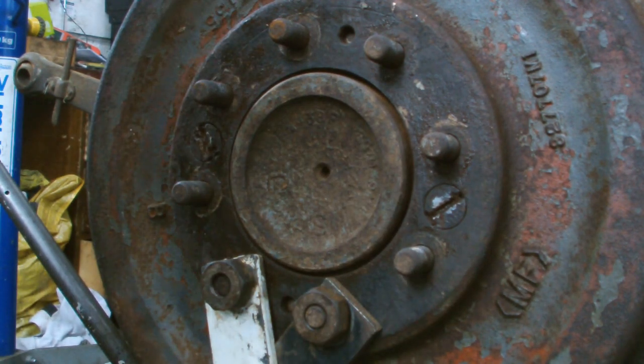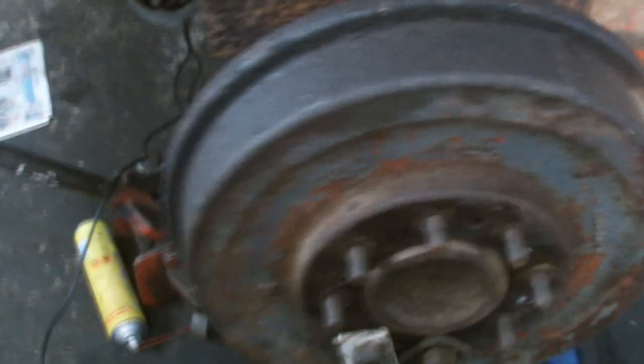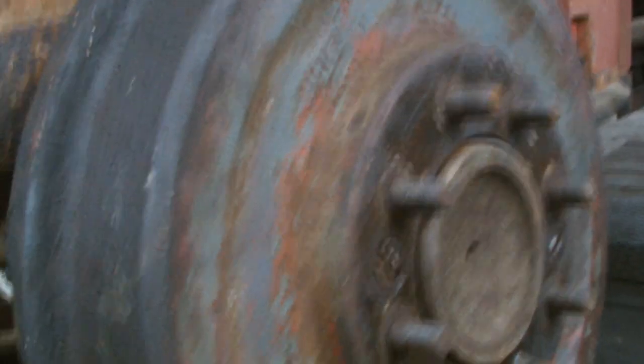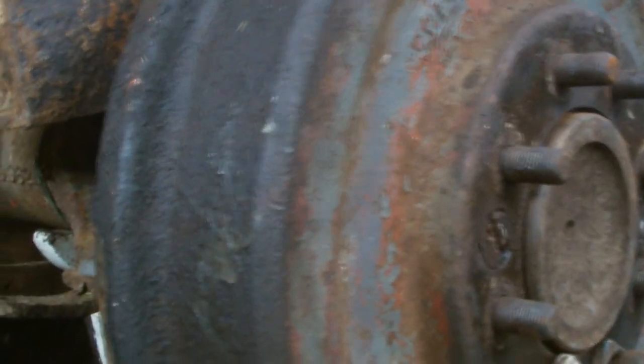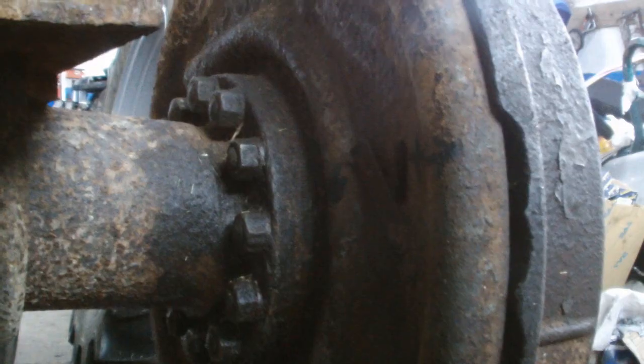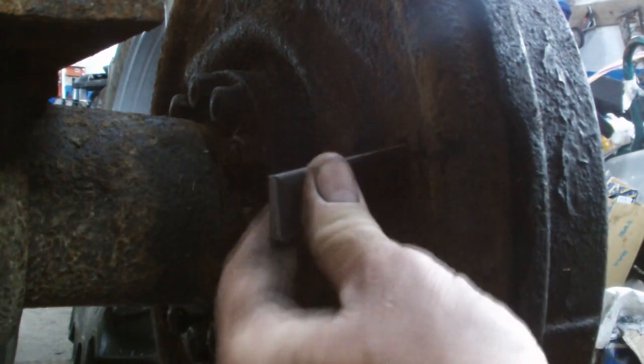He's turning the hub right around when adjusting the brakes. Okay, gearbox in neutral — this one in neutral. Now we can turn the drum nice and free. So we can adjust up the brake using the wee tool there. Once the drum locks up we'll have to back off three or four turns. Now we can turn the little adjusting tool there — you want to be going forward this way.